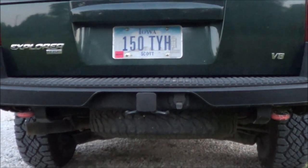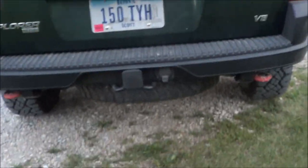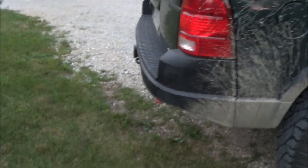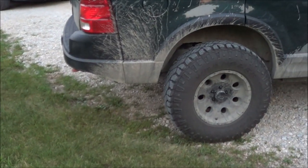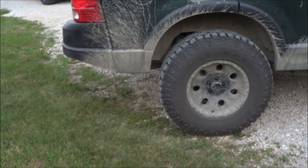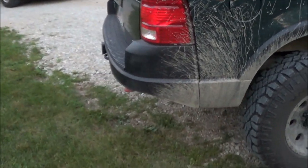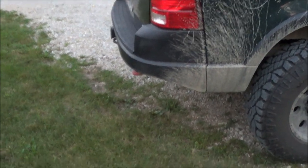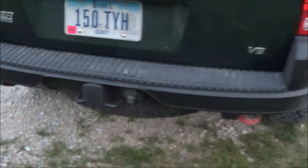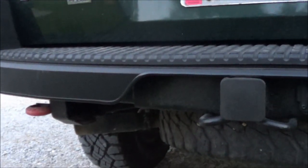To gain a little bit more ground clearance — because these things have kind of a weird fat lower lip where the back bumper sticks out so far — especially if you're running any kind of suspension lift, the geometry works so that as soon as you lift that strut the wheel wants to start coming in towards the inside of the vehicle, which gives you even more overhang. So to help with departure angle, I took the rear crossmember slash receiver off — there are three bolts on each side of the frame rail.